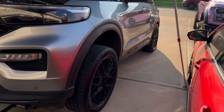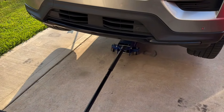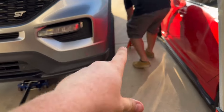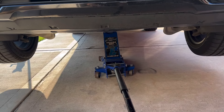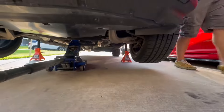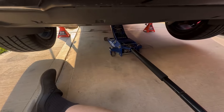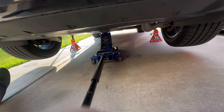All right guys, we've got a brick under the rear wheel. This car has Steeda springs so you can actually fit up underneath the front without a front lip. We jacked up both sides and put jack stands on the pinch welds — very important, don't forget the jack stands. Now you can let off all the pressure on the jack once they're on the stands.